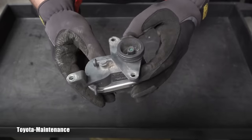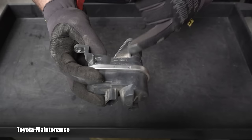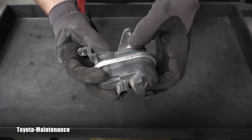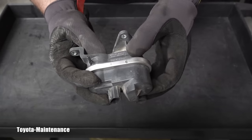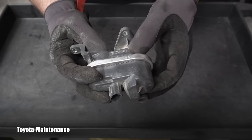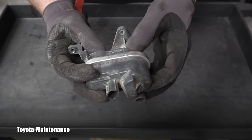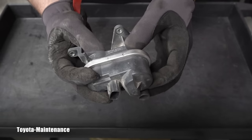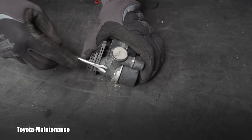When I was looking up these things, the smallest part available from Toyota is that entire charcoal canister assembly. However, this part has both Toyota and Denso part numbers. The Toyota number is 90910-AF001 and the Denso number is 882100-0003, made in Japan.